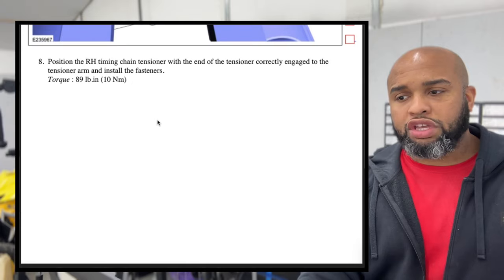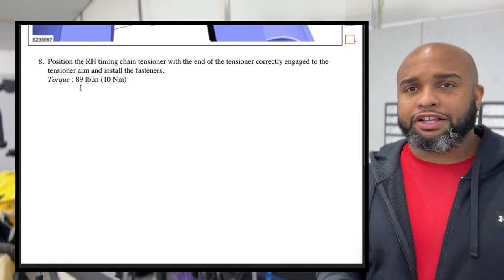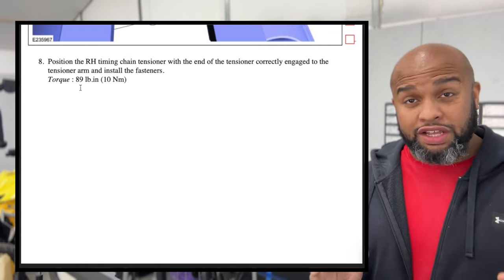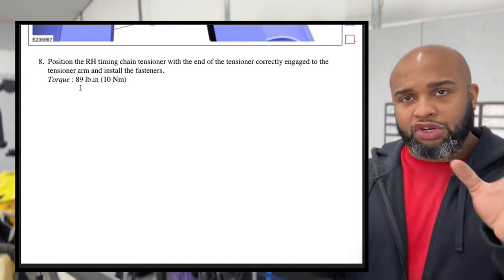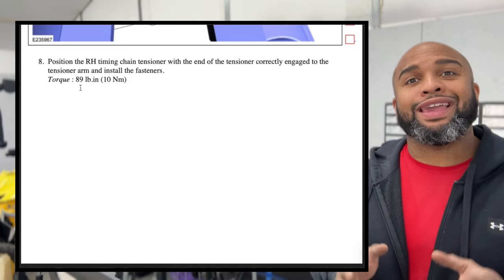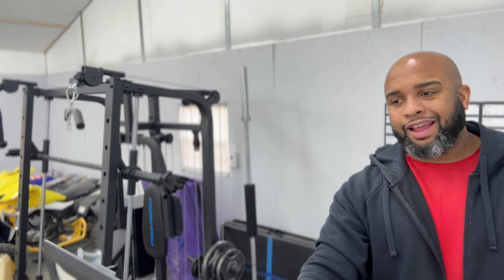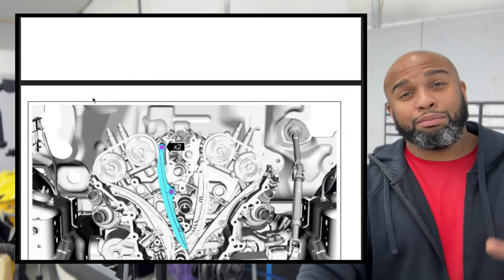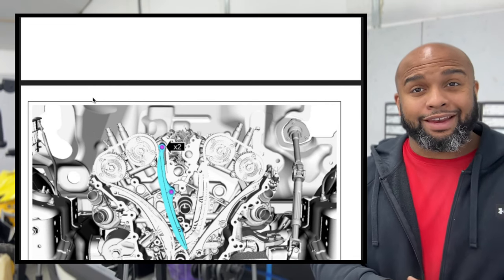These two bolts do get torqued down to 89 inch pounds. That's it, 89 inch pounds. So now we have both of the tensioners installed and we have them down to 89. We're not gonna pull tension yet because we need to make sure we get our slides in there as they should be and those torqued down because there's four bolts on those as well. So the right hand timing slide on both sets is what we're gonna be torquing down to 89 inch pounds